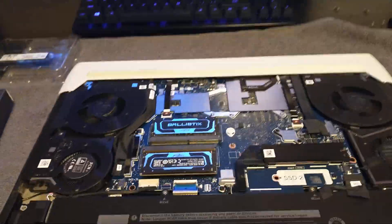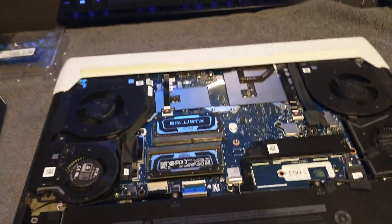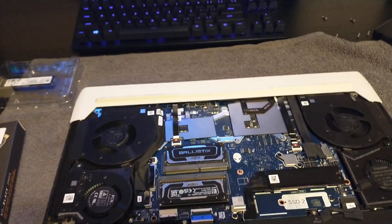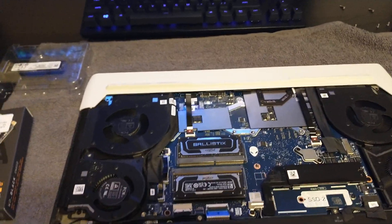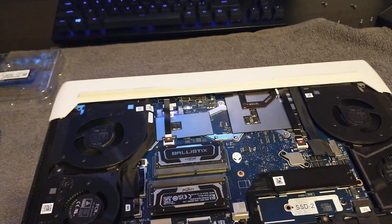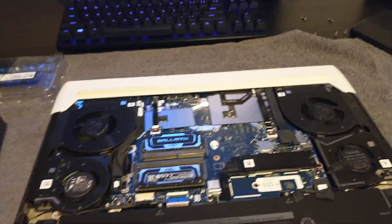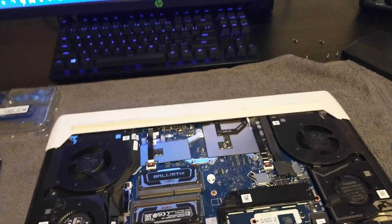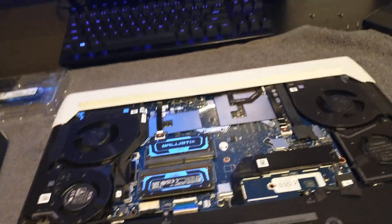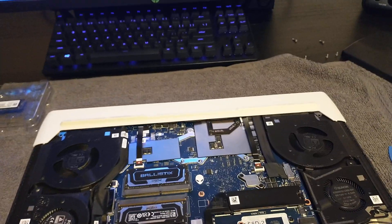What makes all of this possible is that there's no CD-ROM drive and no 2.5" drive bay in here. As laptop manufacturers reach the point where the CPU and GPU die is shrinking — smaller die size means more chips per wafer, lower cost, and more performance — all that freed-up real estate allows Dell to fit four fans in here. That's how they achieved this cooling design with the Intel 11th Gen Core i9-11800H and the NVIDIA RTX 30-series GPU.